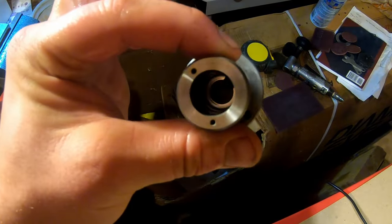So I'm gonna put this piece, I think this is the poppet valve, in the oil, the spring in the oil, this pin in the oil, these two things, put this back together. In the oil, this side down. This little guy just sitting in the oil. Then all these little small parts, they go in the diesel. Also, we're going to need a new big spring in the oil. Actually, yes. New small spring in the diesel. We're gonna use a screw and 2 balls, which I'm gonna leave in here so they don't run away.